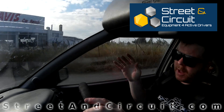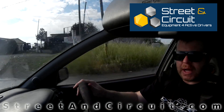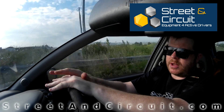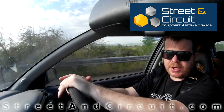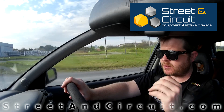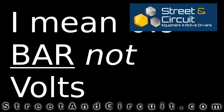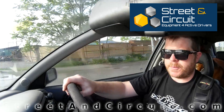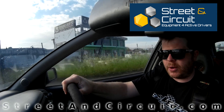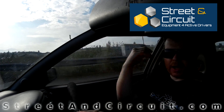For petrol, the tuning box works like this — and this applies to all of them: the boost sensor on the engine reports that the car is making, for example, one bar of boost. The tuning box intercepts that signal, takes the one bar boost signal in, and outputs a signal that says, for example, 0.9 volts. So the ECU sees a boost signal of 0.9 volts and then compensates, adjusting boost pressure back up to one bar where it should be.